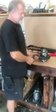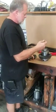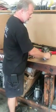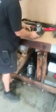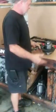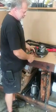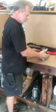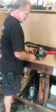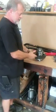We're human beings. We set them up the best you possibly can using gauges and a paint pattern that we mark on this to measure backlash, which is the play you get between the two gears. On an average, you're going to spend probably around 8 thousandths, just to say a ballpark of 8 thousandths, for backlash on this here. That gives a little bit of slack in here for bearing break-in, for gear break-in, so that you can have a proper pattern wearing on this. Like I said, you get a pattern cut on this side, this side, and this side of a gear.